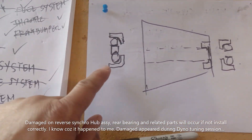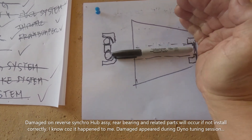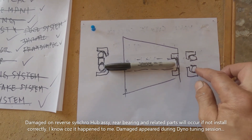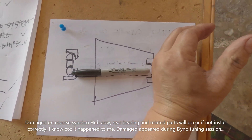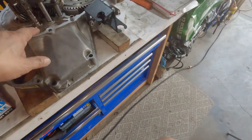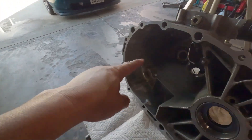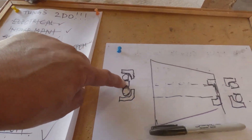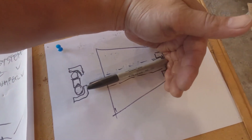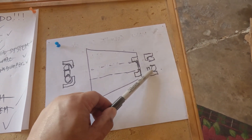Now the shaft has a tendency to go back out — it will have play. Rather than putting it like so, where you are holding the input shaft or the main shaft in place. So if you accidentally put this thing backwards, now you're not holding it together. This bearing is holding it in place in front, and that bearing installed like this, like a cup, is holding the main shaft together. So just pay attention to the outer race on that bearing.